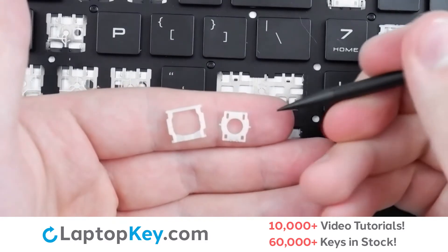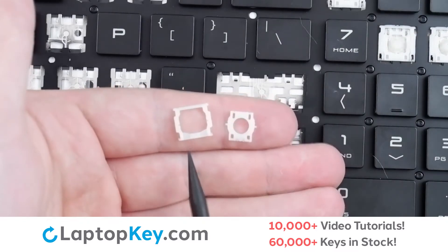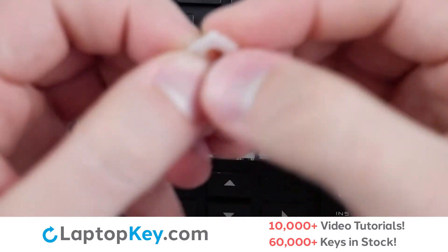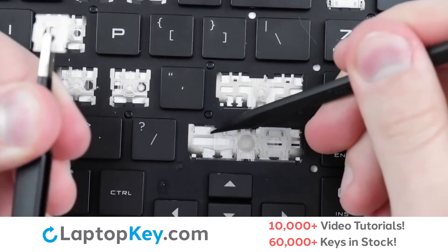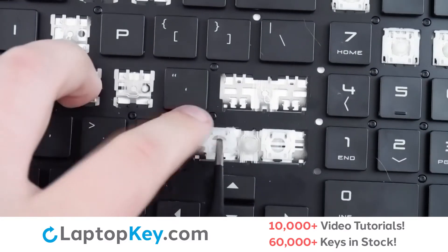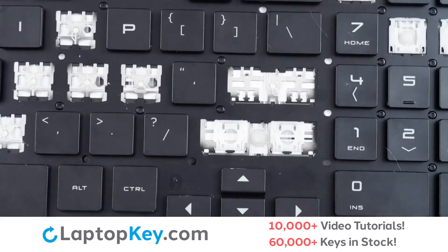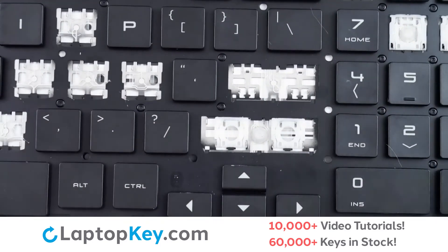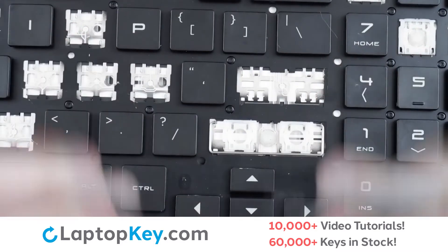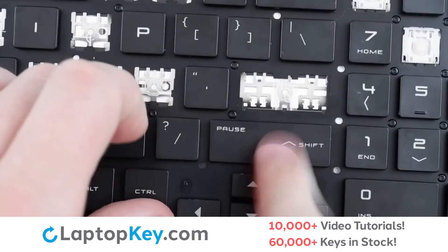To reassemble your clips, we'll begin with the top clip which has two thin holes at the top and two smaller holes at the bottom. For the bottom clip there is a small upward facing notch on the bottom edge. Connect the two halves together, ensuring the plastic support arms of the top go into the holes on the bottom. Then using metal hooks here, here, here, and here, we will lay the clip down top first, ensuring it hooks on. Lay down flat, press at the bottom corners. Then using holes here and here, we'll replace the metal support arm, pushing one side in, then the other, and laying down flat at the bottom. Place our key cap on top, firm press from the edges and in the center, and we're functional.